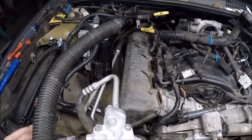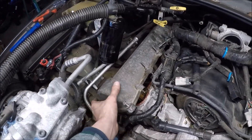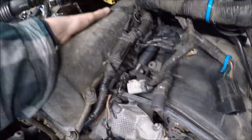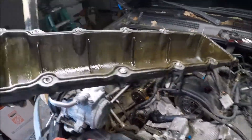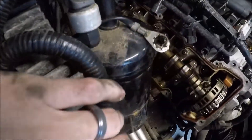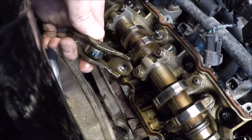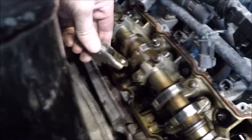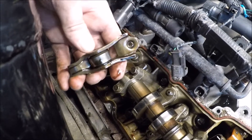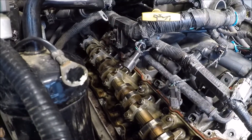It was starting to get kind of dark and cold last night, so I decided to wait until the next day to show you this. I did manage to get this valve cover removed. Check this out — you can see right here that is a rocker arm just sitting right inside of the cylinder head. This 100% is my problem and hopefully no further diagnosis is needed. This is certainly the reason why this engine was running terribly. You can see the lifter here — I believe this is an exhaust lobe.